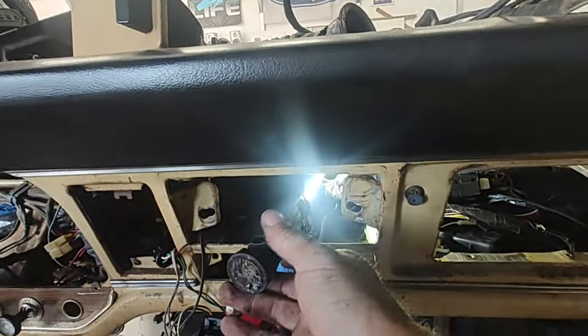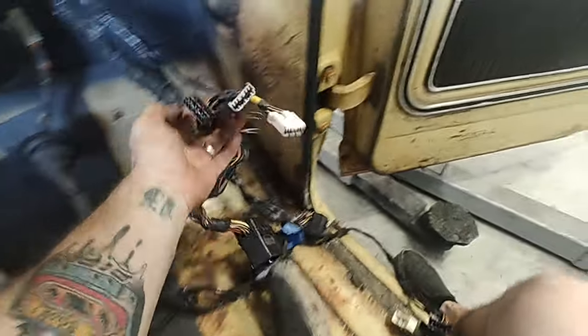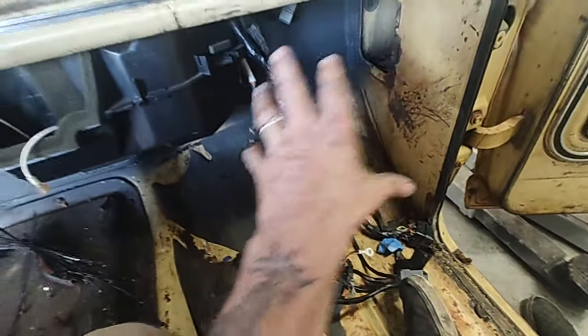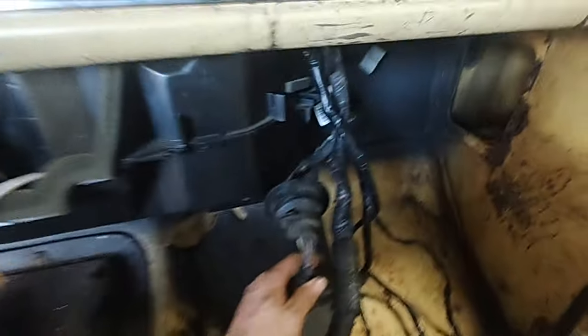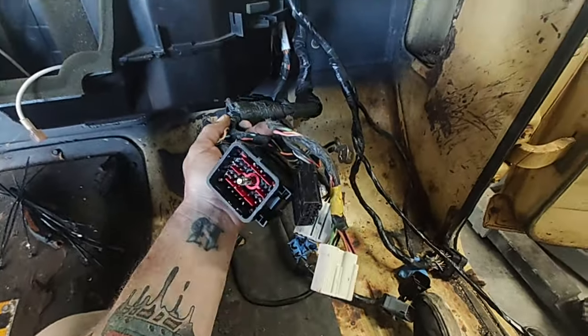There were two sections that we put in here — the first section and the second section — and they're going to click into each other. The three plugs that you had on the firewall over here in the Crown Vic that went on that little plastic thing go into these three wires that came in from the other one. We'll plug those together, tuck all this stuff together and cram it up there. We're going to get rid of all that stuff except for the one that's going to go through the firewall. We're going to cut a hole right there and run that through the firewall and it'll plug into the top of the AC box. Just go through here and start figuring out what goes into what. I like to tuck the plugs up in here and clean it up out of the way behind the glove box. We'll grind down a spot over here and do all our grounds into there.